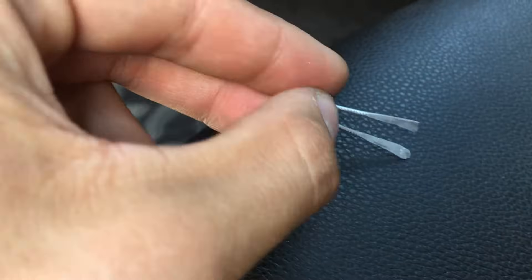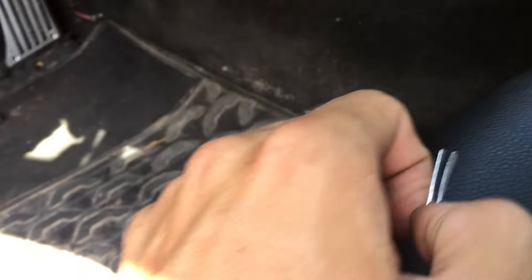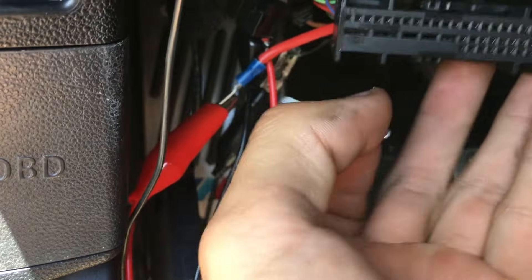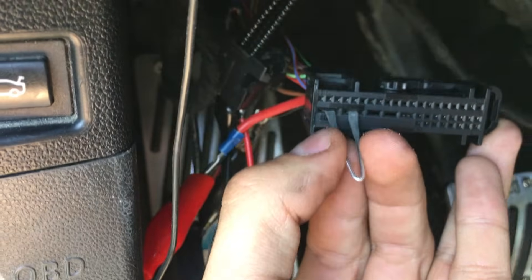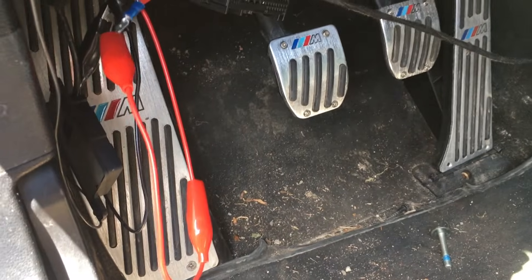Here's my little wire — I flattened the ends out. This is just a piece of aluminum wire, don't use soldering wire, and no it's not gonna shock you. Hook these two terminals together. You hear that? That was the car trying to start. Again, we have the fuel pump unplugged so it won't fully start, but that's a quick test. If this helped, could you like, comment, and subscribe? Thank you very much.